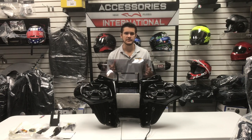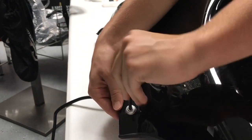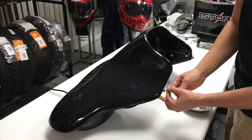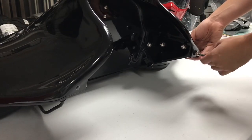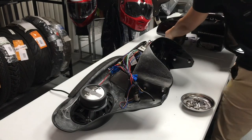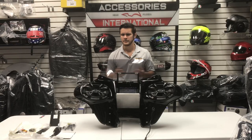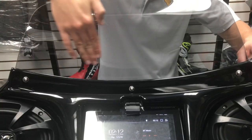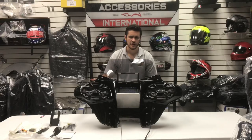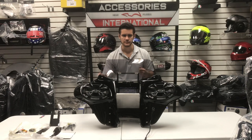The fairing is made in two pieces which allows easy access for any rider who may want to open the fairing to give maintenance to the inside or check their speakers and stereo. The two-piece fairing design also allows riders to eventually upgrade their stereo system by easily accessing the insides, rather than a one-piece fairing which typically forces riders to stick their hands through the speaker holes. To open the fairing, you'll simply unbolt the five bolts — the three on top and the two on the bottom — and separate the two fairing pieces.